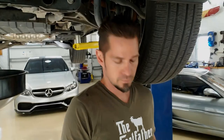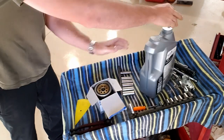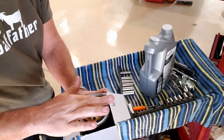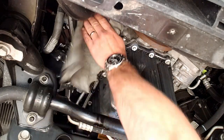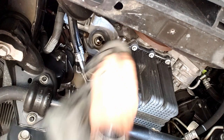We're almost done draining. Next thing is to put the oil filter on. One of my pet peeves — I never install these dry, I always fill them up as much as I possibly can. On a car where they install straight up I'll fill it to the brim, so when you start the car it instantly gets oil pressure with no dry bearings. On this one it's angled so we can only fill it partway, but any bit helps — once it settles it'll probably be about two-thirds full, which is fine. Of course, put a slight smearing of oil around the gasket so it slides on easily. I like to let everything drain until the drips stop to get every bit of old oil out.